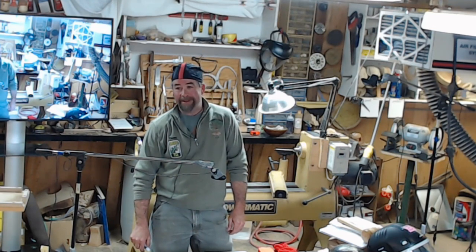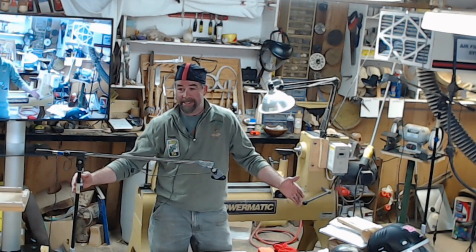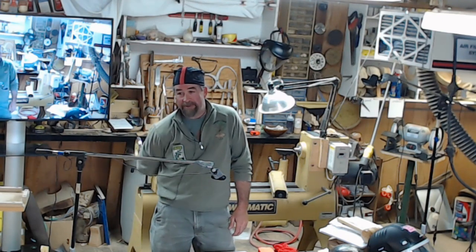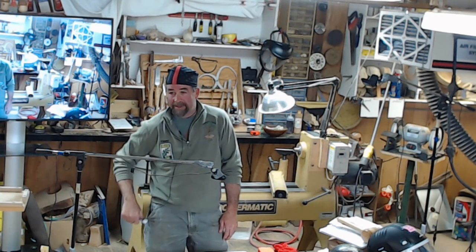Usually if you have to move from one side of the tree to the other with the same saw, say you've got a 30-inch diameter tree and a 16-inch saw, you should be upping the size of that because you're just not making a fast enough cut, or this thing can break out before you have a chance to even really cut it. So I would wait or hire somebody, or get one of your buddies that has a bigger saw and experience to come in and do it properly.